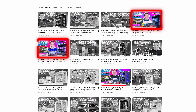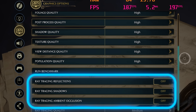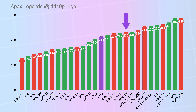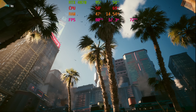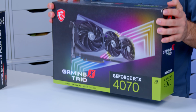I'm going to be pairing it today with an RTX 4070 GPU. A lot of my builds tend to be more AMD than NVIDIA, especially at these price points, because when it comes to rasterization — straight gaming performance, no ray tracing, no DLSS, no FSR — AMD tends to win out and has a bit more power, plus you tend to get more VRAM. However, the 4070 is still a fantastic card. While it is slightly more expensive than AMD's RX 7800 XT, you still get 12GB of video memory and far superior DLSS and ray tracing support. The 4070 is just a more popular GPU, and I think it's a really well-balanced option for this build.